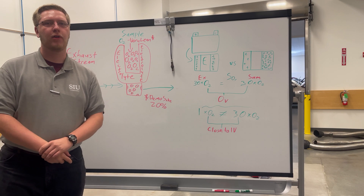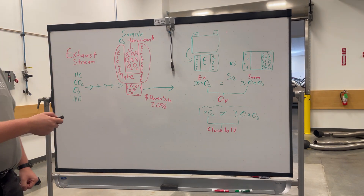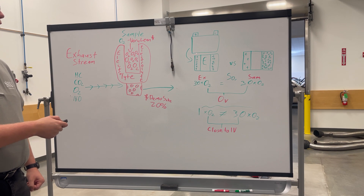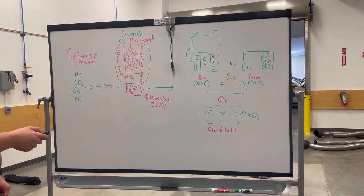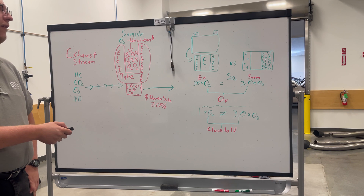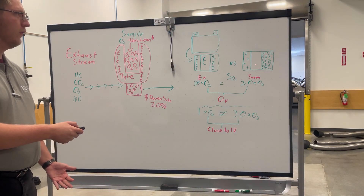To begin the video, I'll explain how an oxygen sensor works. The first thing we need to understand is how a battery operates. It runs off the principle of two dissimilar metals and an electrolyte. If you have two similar metals and an electrolyte, you won't produce any voltage, whereas if you have very dissimilar metals and an electrolyte, you're going to produce more voltage.